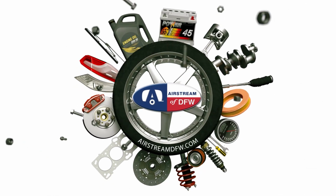One thing to note, finally, is if you have the step out, if you've left the awning out, or maybe the stabilizers down, or possibly the slide out, you will get a travel warning here. So if you see this red light lit up, that means that one of the items has not been stowed properly. You can look at the Firefly display and it will tell you which one it is. Make sure that you cycle through all four of those items. It's only ever gonna be the main entry door is open, the awning was left out, the slide out was left out, or your stabilizer jacks are down.